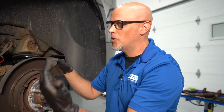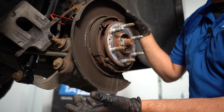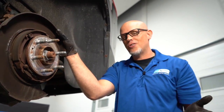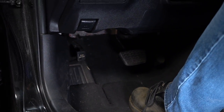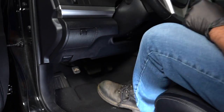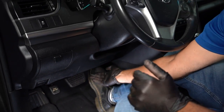Take a look at the shield — mostly it keeps rocks out of hitting your rotor, but it could be dented or severely rotted and rubbing on the rotor. Most of that's just going to give you an annoying noise; it's not necessarily a safety item, but it's something you want to look at. Everyone always forgets to check the parking brake, so make sure you try that — make sure it holds the car both going forward and in reverse. When making the adjustment, you want minimal contact, just barely rubbing. If you notice a burning smell coming from the rear while driving, it's probably because you tightened them up too tight. Also take a look at the brake pedal — sometimes the rubber wears out or falls off, and these are fairly inexpensive and easy to replace.